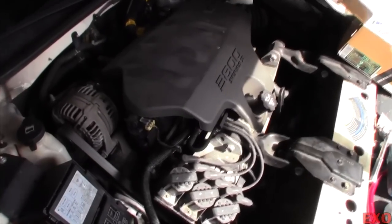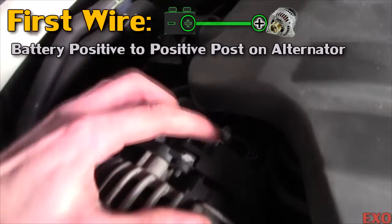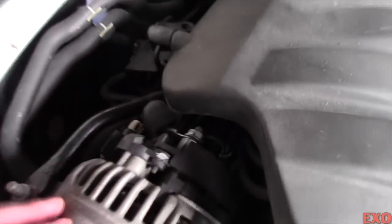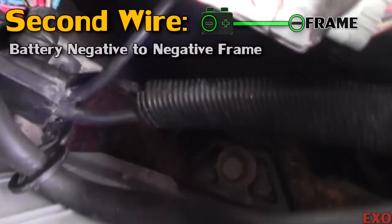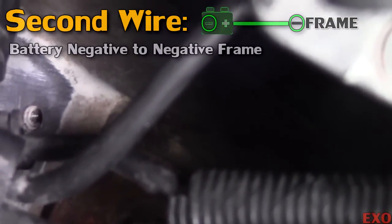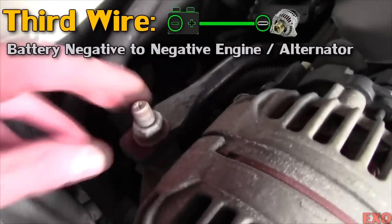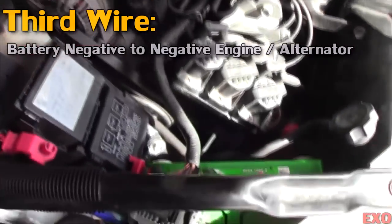Let's start by explaining where each individual wire is gonna go. We're gonna start here with the positive terminal on the battery, run it down and around nice and clean to the positive post of the alternator. That's gonna be the first connection: positive battery to the positive post of the alternator. The second connection is gonna be on the ground, on a spot where you pick to ground it to your frame. We got our ground right there where she can bolt down nice and secure. That's gonna be the second connection. Then the third connection — why they call it the big three upgrade — is from the negative post to this bolt right here, which grounds your alternator through all this hardy metal through the engine. That is the big three upgrade.